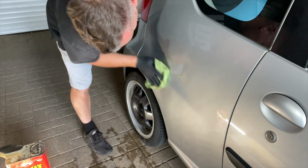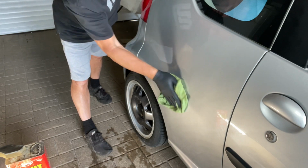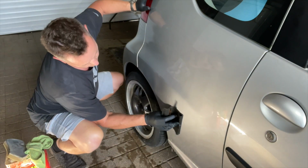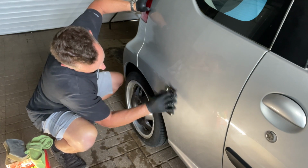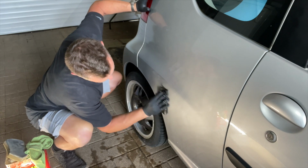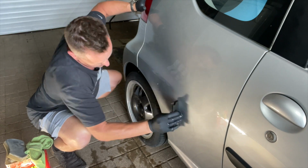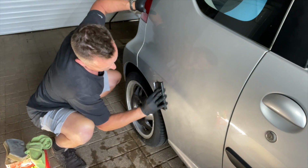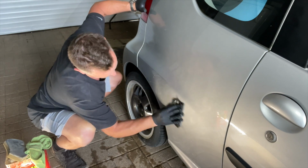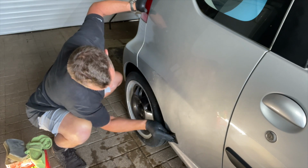Just got a little bit of overspray around this area here. You can just hear it a bit rough. This up here's nice though now. You can actually hear that, the roughness as I'm rubbing the wet and dry over the overspray, so you know when you've got it smooth, because that will stop. I just keep working at it, and then I'll buff it back with T-Cut again and really get that shine up.